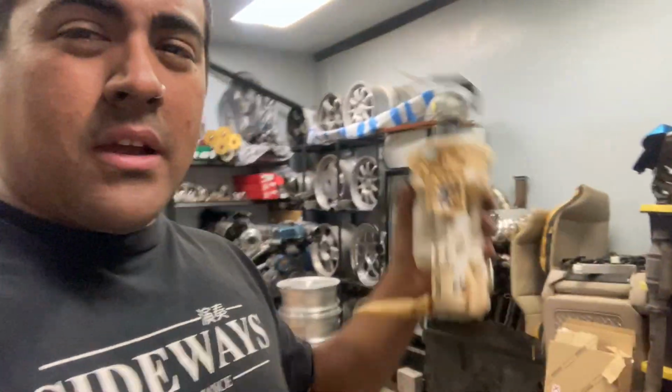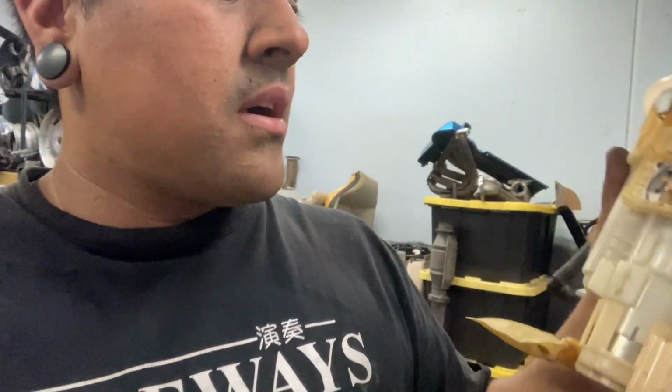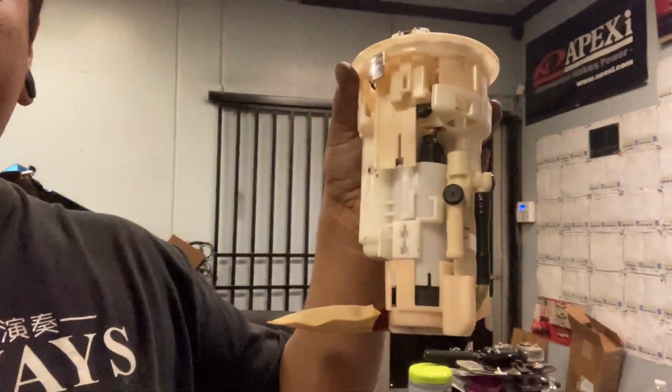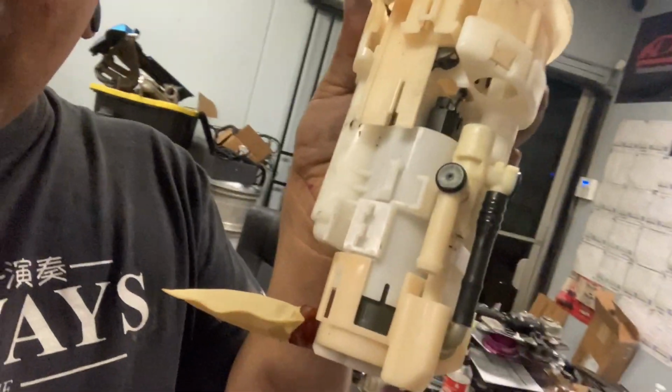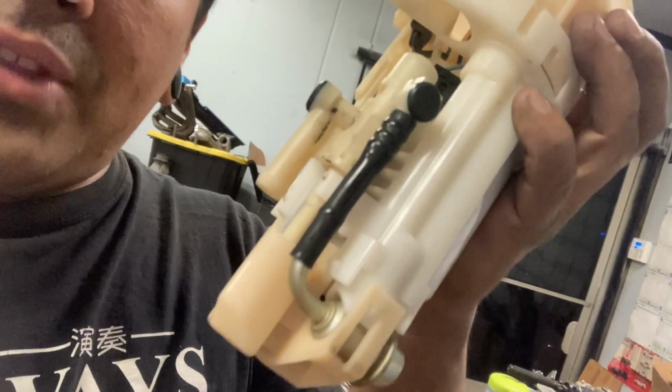Also wanted to take a minute to go over this hanger. This is your OEM IS300 hanger, the one that we just pulled out of Squire's car. Obviously, on the actual hanger itself, we've already gone ahead and pulled out the level unit. You can see it just slides right out with 2 clips. But this is what it all looks like. This is your OEM Venturi right there on the side, with the regulator that regulates the fuel pump for fuel pressure and everything right there too.